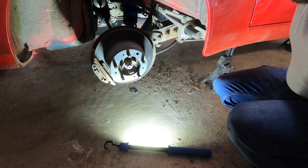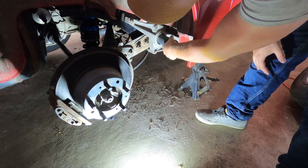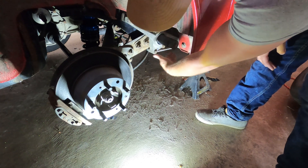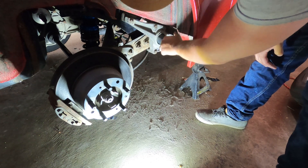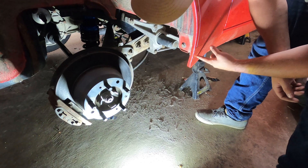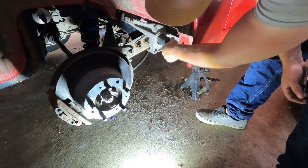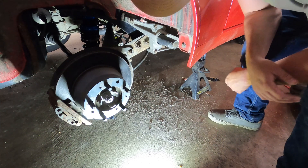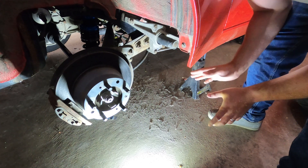The wrong way to do it — and hopefully you can see this — is where the torsion bar sits in this end: you could actually use a sawzall or hacksaw blade, cut straight down, cut the end of it off, and pull it out a little bit at a time, cut it off, then build an end cap for this. If I were going to do this all over again, that's exactly what I would do. I know there are guys who run race cars who cut holes in the body, cut the end cap off the first time, and then just go in and re-index as needed for suspension travel, rebound, and things like that. That's how I would do it.